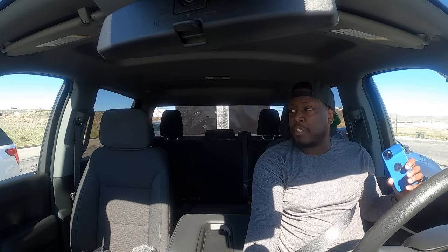And yeah, at 50 miles an hour and less, you don't really notice the difference. Tire pressure does make a difference, but you can feel the trailer just pulling this truck left and right. And you can't really fix it. The only way you can really fix a lot of sway from a trailer is obviously having a weight distribution hitch. Now, if you do have a lot of trailer sway, you use your trailer brake to apply the brakes back there and just keep driving. That'll straighten the trailer up a little bit, but honestly, it's not bad enough to where you have to do that. It's just, this truck is too light, has a short wheelbase, and it's not really set up for this type of application, especially towing 9,000 pounds.